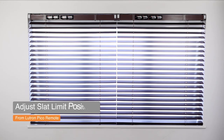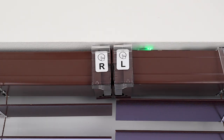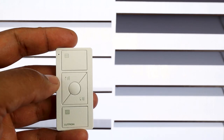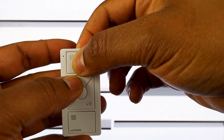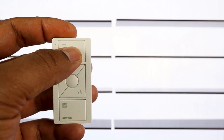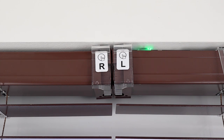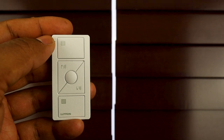My blinds worked and aligned very well straight out of the box. But if for any reason you find your blinds unaligned, or if you want to adjust the view position: first tap the shade button on the blind to turn it green. Then on the Pico assigned to that blind, press and hold the view button and tilt up button together until the shade button flashes green and then returns to steady green. At that point, use the tilt up or tilt down button to adjust the blind. Once you're happy with the slat position, press and hold the view button — the shade button will flash green and then turn off to confirm the adjustment is complete.